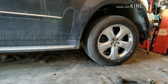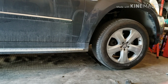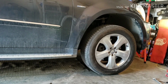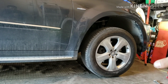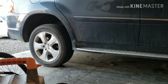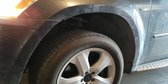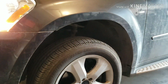All right, so after changing all three bags, rear shocks, I did not show the how-to on this side because I just wanted to get it done and I don't have time to film and everything. So this is the result now, from the fender to the tire is about 7 inches. This one's about 8. Same thing on the other side. So this is the result. It's idling nice. Show you on the other side here. This is the other side. You see that it's way up, really high now. So yeah, thanks for watching.